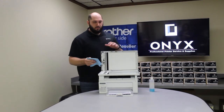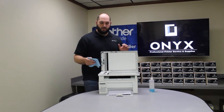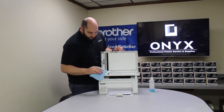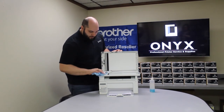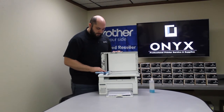As mentioned, we're starting to see some defects when scanning from the document feeder on the top of the printer. So we're going to focus on the small strip of glass on the left side of the printer. We're just going to clean it and make sure that we're not seeing any ink, white out, adhesive, or anything like that that's built up on the glass.